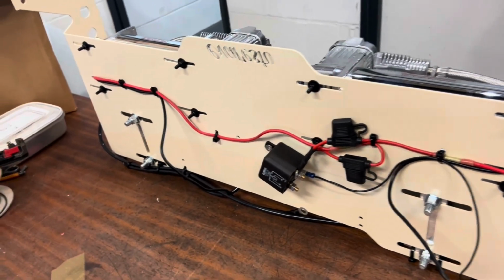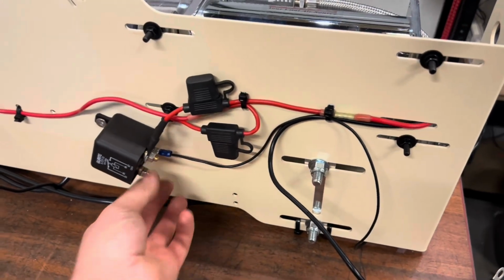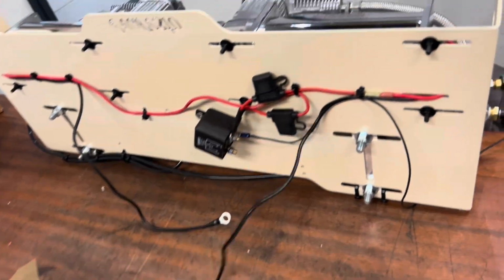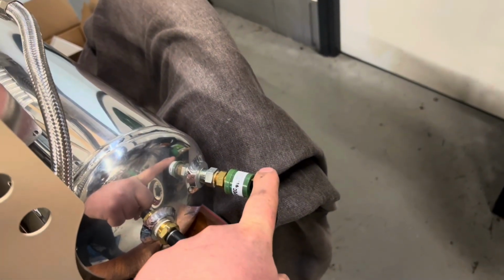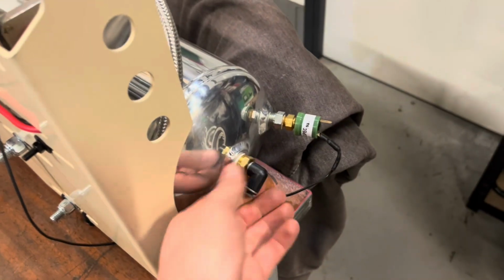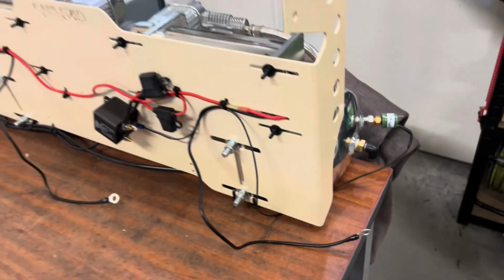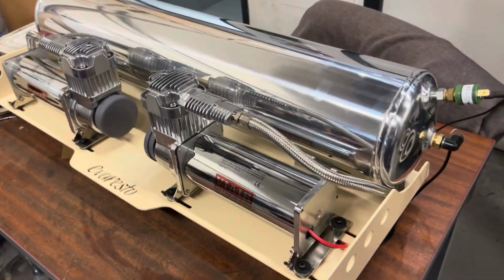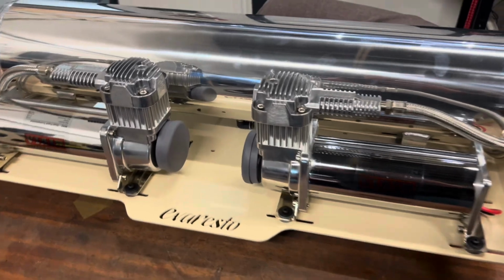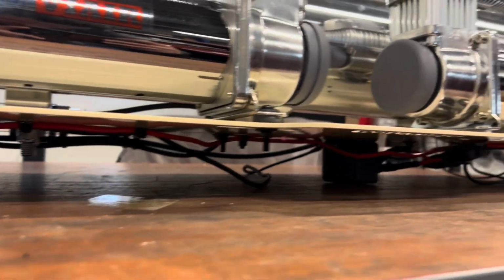There's not much to plug in once it goes in the car. Got to connect the main power line to this part here, and then both these compressors have their own earths, and then we've got to connect a positive, an ignition live, to the other side of this pressure switch, and of course pipe this here in to our management underneath the dashboard. And that's it really. So from the top, it all looks very nice and neat, exactly how we like it. And underneath, hidden out of the way, is all the stuff that makes it work.